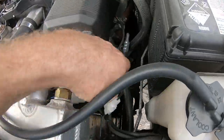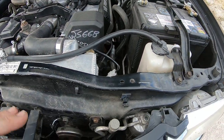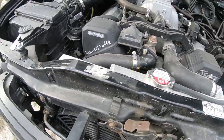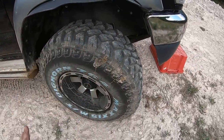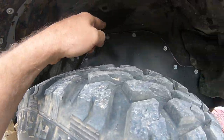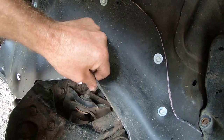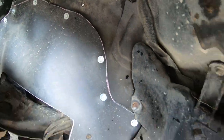This engine didn't actually come with an air conditioning pump, so that's been fitted up, and the standard condenser has been used in the front. We've also added a couple of extra fuses in the front. To make these big wheels fit, we've had to trim a little bit at the back, and we fitted big inner guards — thick rubber inner guards we made up. Hidden under there, of course, are our engine mounts — the race mounts we've made up — and the extractors.